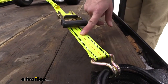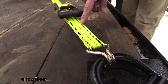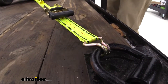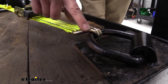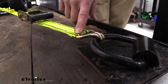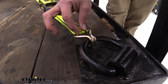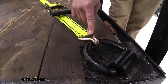The connection points where our strap is doubled over are really nice and sturdy. I like all the stitching that they've got in here, giving them that really high weight capacity. The hooks are going to be a double J style — you can see we've got one that comes around making a constant loop. I like the way the straps sit on this style versus the S style hook, which is rounded so our strap tends to bunch up, whereas here it's spread out over a greater area.